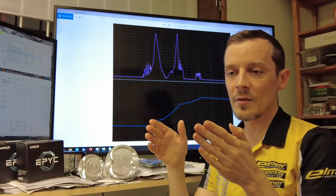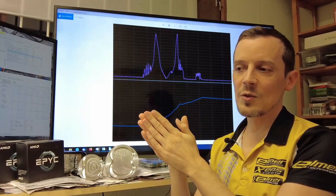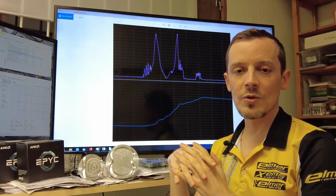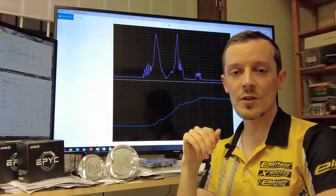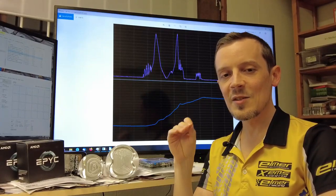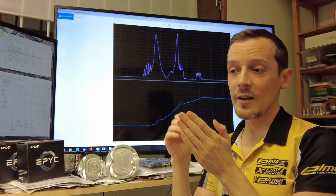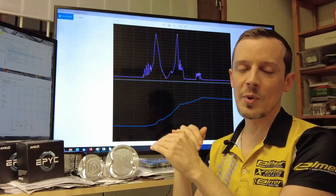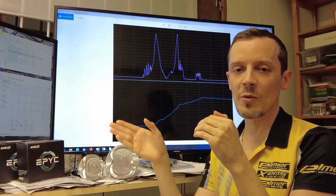Things break and there are issues, so you need to go up in the RPM range as well. Our engine is designed to utilize the maximum 9,500 RPM that the FIA supercar rallycross custom engine rules allow for, and we maintain relatively good efficiency so you're not losing too much power when going past the peak performance RPM upwards.